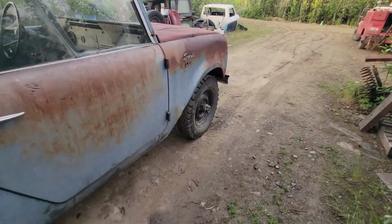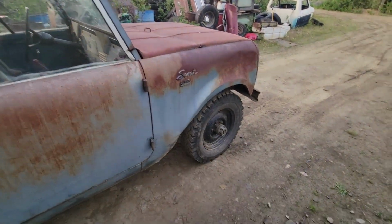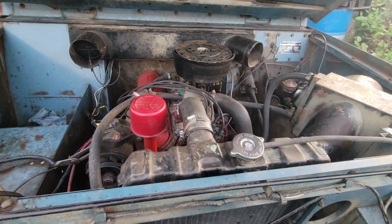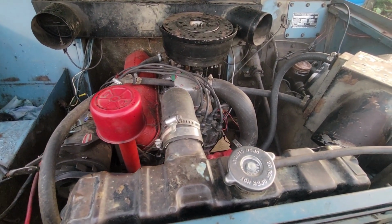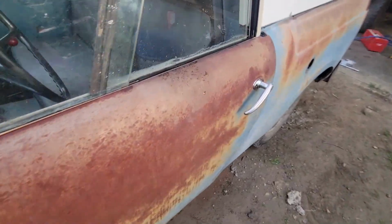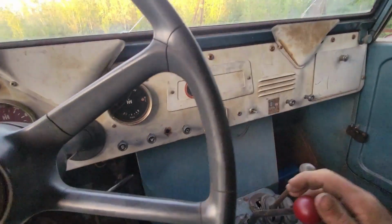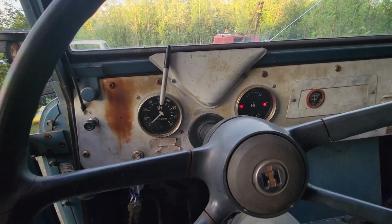And shoot, yeah, I don't know. I'm gonna call her a video here. I got a lot of work done on this little thing. The other night, actually, I went ahead and hooked up the vacuum gauge to the little 4-cylinder, and I tuned on the carburetor a smidge, adjusted the idle air, and then I adjusted on the timing a smidge, so it's running a lot smoother now, and it fires up a lot easier. We'll see if it'll start right now for us. Oh yeah.